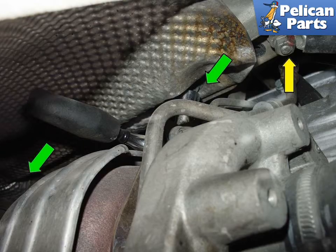To replace the plugs and coils, you're going to need to firstly safely raise and support the vehicle, as well as remove the rear bumper and the intercooler console. Please follow the link provided at the end of this video for additional assistance with those tasks.